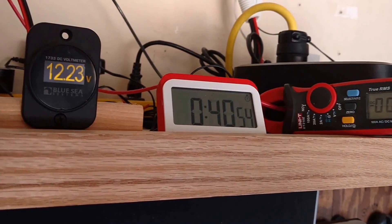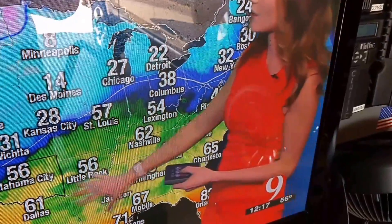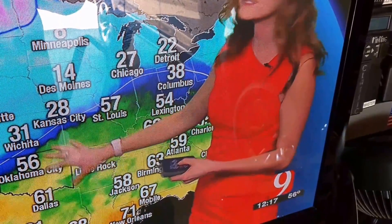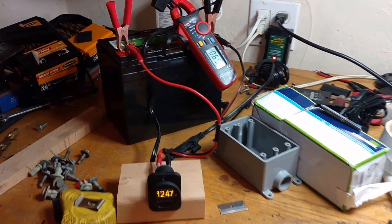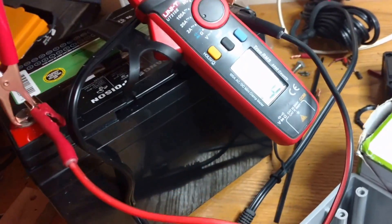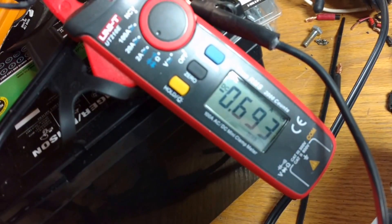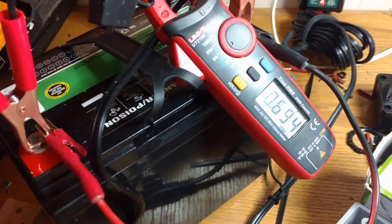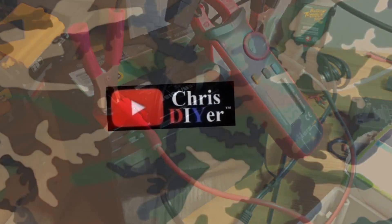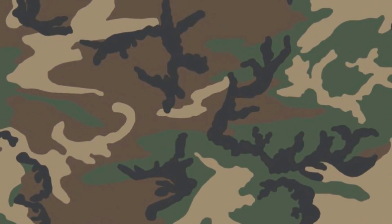Here it is charging — this is what I want to show you. This thing charges at only 300 milliamps, which is one thing I don't like about this charger. The other thing is it only goes up to 13.5 volts and then it's done. So I took it over to my workbench and hooked it into my Battery Tender Junior, which charges at about 700 to 750 milliamps and goes up to about 14.2 volts. This battery is actually stamped that you want to daily-cycle it past 14.5 volts, so even the Battery Tender Junior won't bring it all the way up.